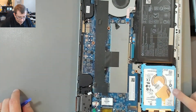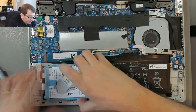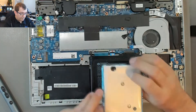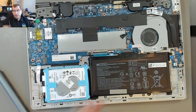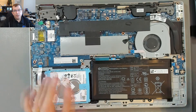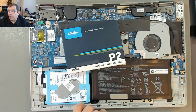So this battery feels fine. There's the mechanical hard drive. This has an M.2 slot — I think I'm going to replace this hard drive with an M.2 drive. I can actually do the disk cloning in situ here. Instead of taking this out and putting it in my computer to do it, I'll just boot into MiniTool Partition Wizard's boot USB drive. I'll put the M.2 drive in here so then I'll have both drives and I'll be able to clone from one to the other within this computer. These Crucial P2 drives are pretty inexpensive, so let me just order a new one of those.